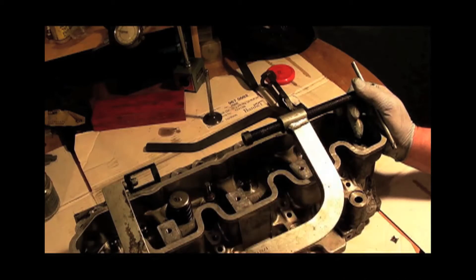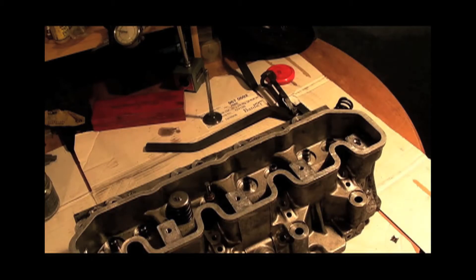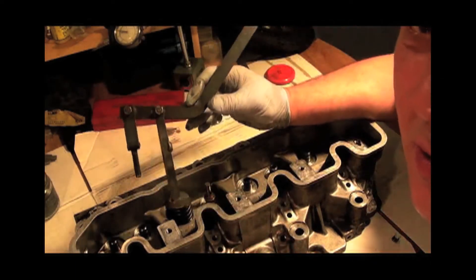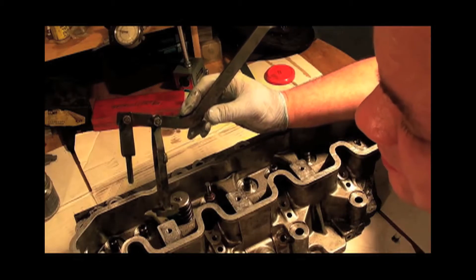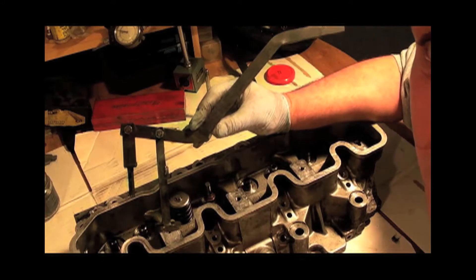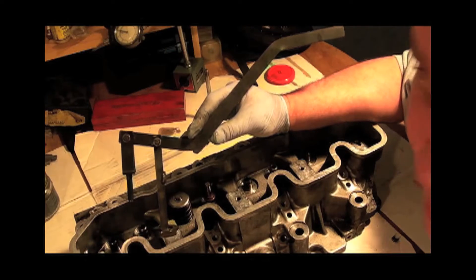That's on the other side of the cylinder head as you can see in the demonstration. I'll show you another one which is a neat trick — this is more for advanced people. This one you can get from any shop — this little baby here is an overhead valve spring compressor. You'll find them useful on the 2.25 diesel, or in this case the EM55 which is a Peugeot diesel fitted in the LDV and also in some Land Rovers.